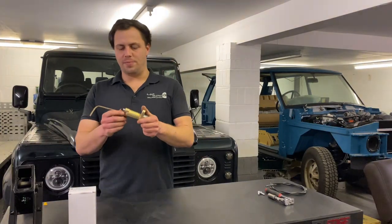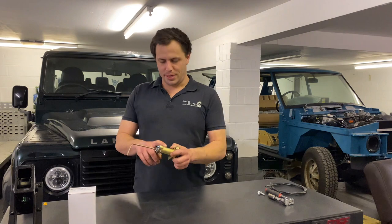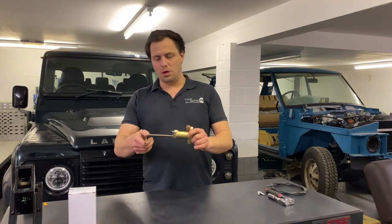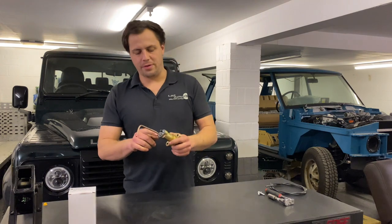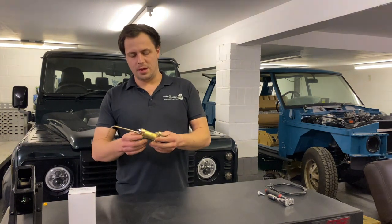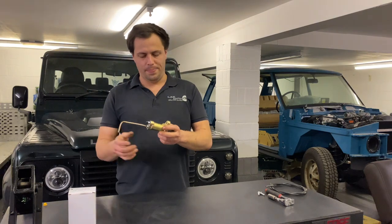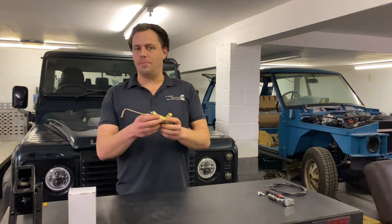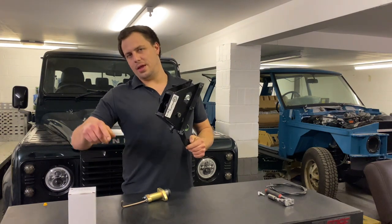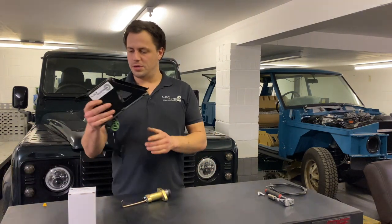A bit of troubleshooting with the Power Slave: if you've got any issues, the first one would be that the biting point is very low. That can be down to air in the slave cylinder, so check that you've got the bleed nipple at the top. Next, check that the union is tight and the pipe can't be rotated — sometimes the flaring on the end of the pipe can be crushed and won't give a good seal. Also, if the clutch isn't worn in enough, fitting it with a brand new clutch can give you a lower biting point. Another trick for getting the air out is to actually wedge the pedal down overnight, which allows any air to rise out of the clutch system.